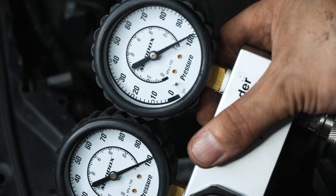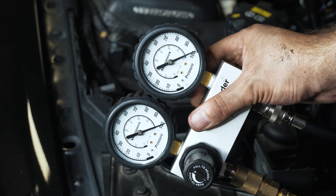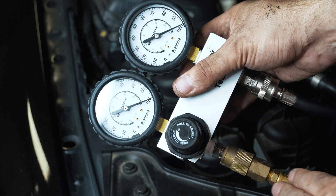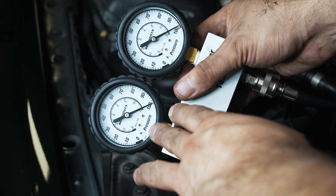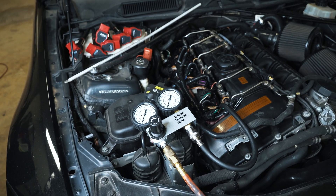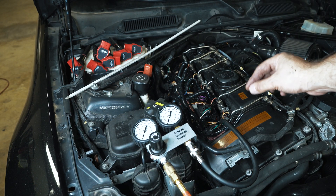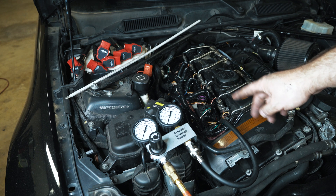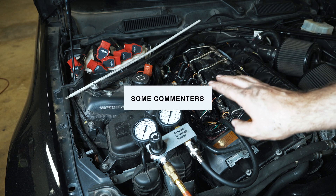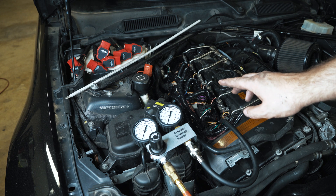I don't think you could ask for more. For a stone cold engine, I think that's as good as new — there's no funny noises, no air leaking. The only leak I have is around this fitting here because I don't have a perfect seal, but that doesn't matter. In my compression test video, some people gave me flak saying you can make the compression test look good by having the motor hot and letting it cool down exactly one hour with thick oil in there — but then do a leak down test, it tells you everything.